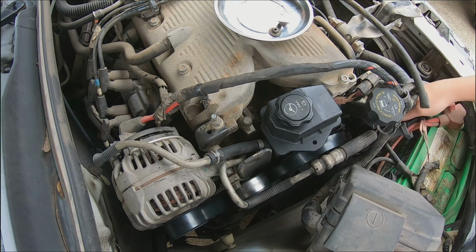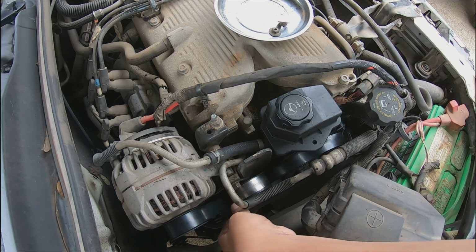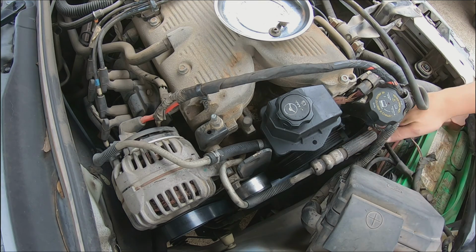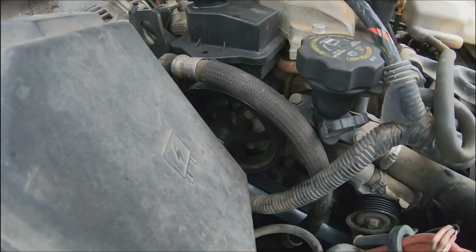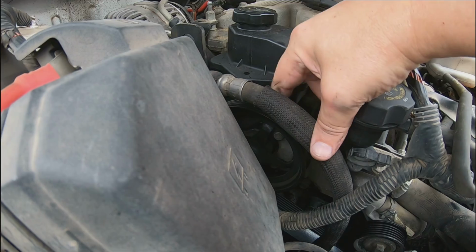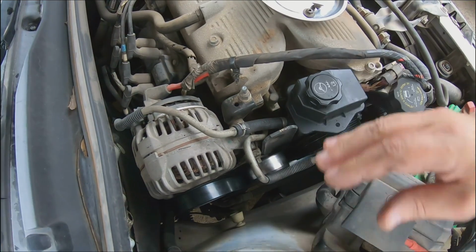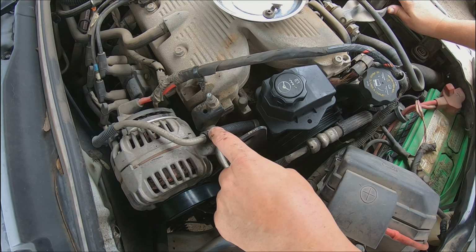And what I did when I pulled up on that tensioner, I just popped it loose from this idler pulley that's up front of the engine right here. All right. And all you got is, let me show you here. You can see a bolt here, there's a bolt there, and then there's another bolt that as you move the pulley, you'll be able to get to it kind of on the back side. Hopefully that's coming through. So let me grab a ratchet. Actually, I guess before that, I'm going to take some pliers and we're going to get these hoses off here.